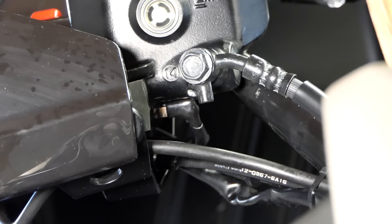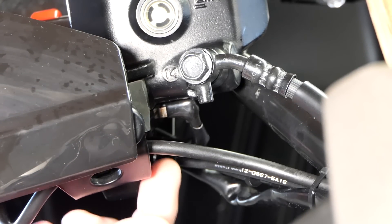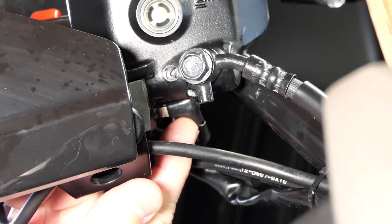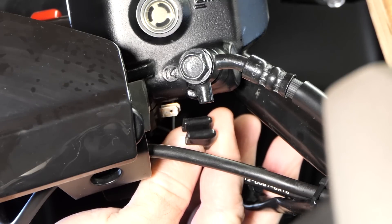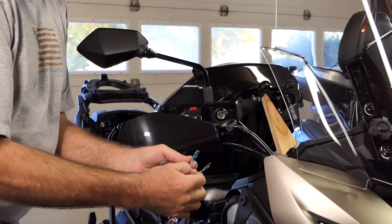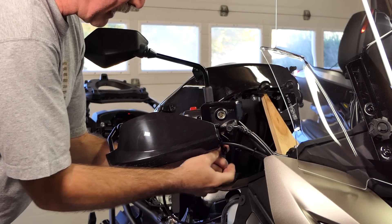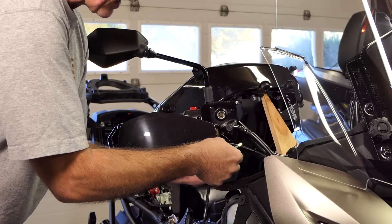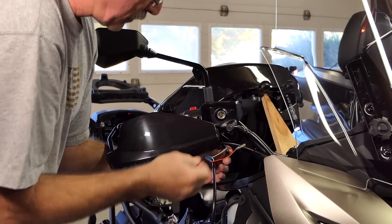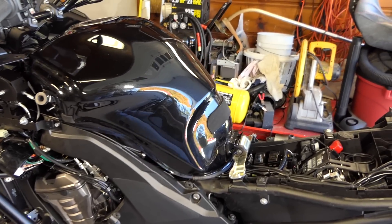Over on the brake side, we hook up our harness wires for the brake switch, located right underneath the master cylinder. I pulled both wires off the switch — you can see the terminals on the switch. On the end of our cable we've got two male spades and two females. The two wires we unplugged are females, so we put the spades into those that came off the switch, and the other two females plug onto the switch terminals — completing our connection.